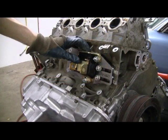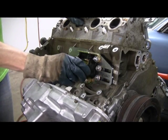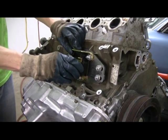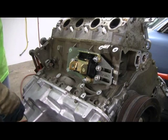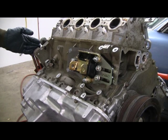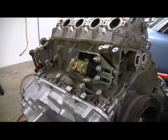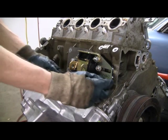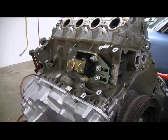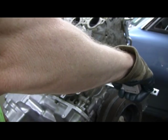To go back to what we did last week — these are the Dirty Dingo slider mounts. This is the front of the engine. These are adjustable so I can get my setback right. All the way forward with the Dirty Dingoes makes the engine mount the same distance from the back of the block as the Gen 1 is. I know that's not going to be enough space, so we're going to start with it about an inch forward — actually, let's try three-quarters first.